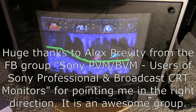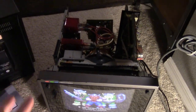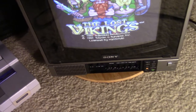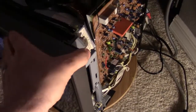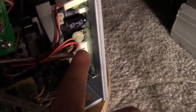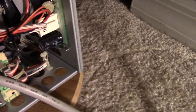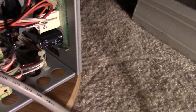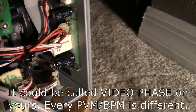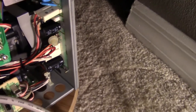Now in order to fix this I actually got some help online. That being said, what you need to do is actually really simple. There's no knob that you can turn to adjust the angle. Instead what you need is — let me just swivel this around — I have it on a little lazy susan here which makes it a little easier to show. You're looking for a potentiometer on the back hand side here, you see this little guy right there. And if you look at the side, that is called the H Center 2. So basically it is the knob that centers the horizontal image alignment. And that is the one that we need to turn.